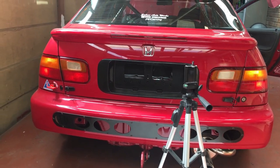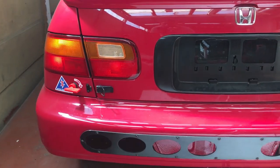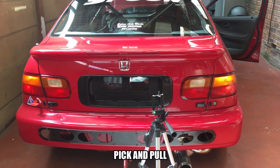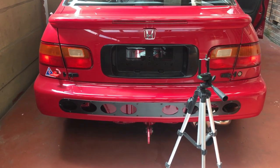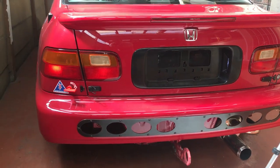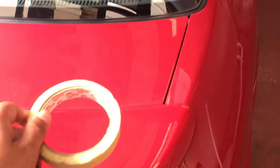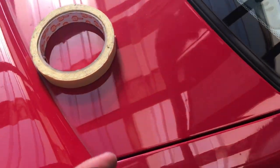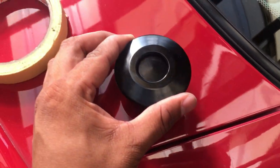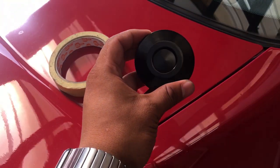In the meanwhile we'll use those small plugs, but in future I'm going to use one of those adapters — I might be able to find those at a scrap yard from a previous car. I want to get started with the quick latches in the next part of the video. I'm going to remove the wires, tape up the area where I'm going to cut, place the latch down on the tape, use a pencil to mark where I'd like it to sit, and then start drilling.